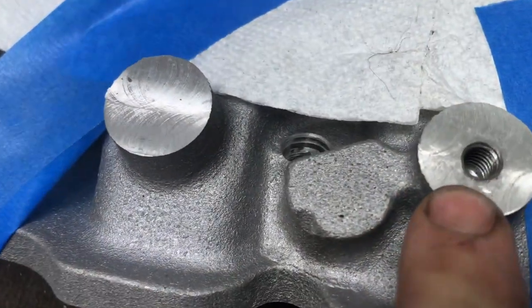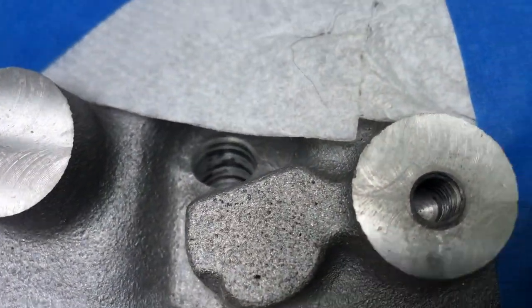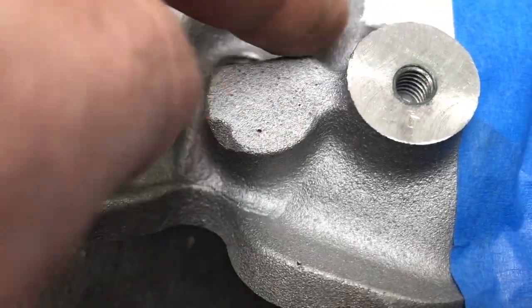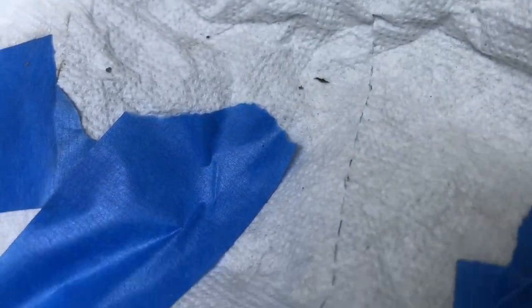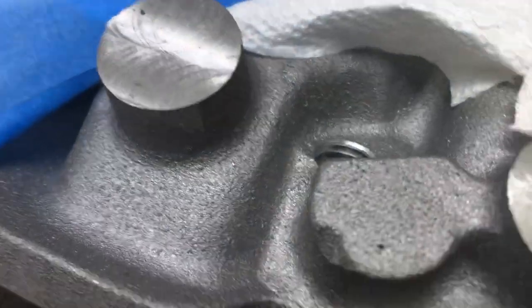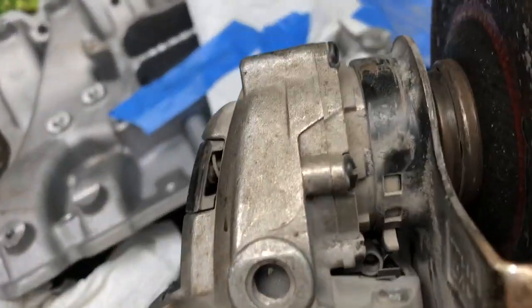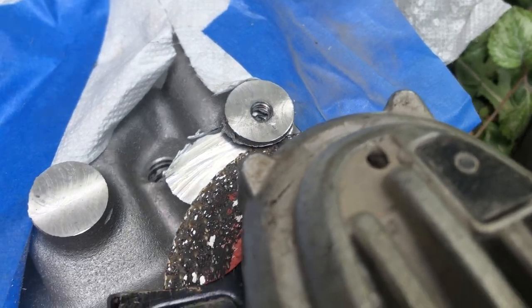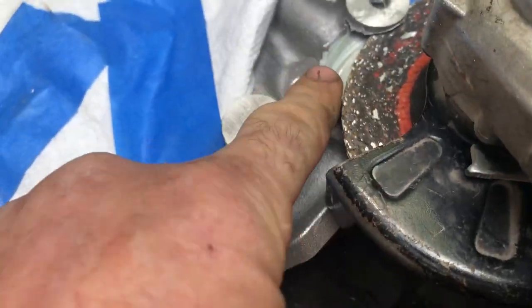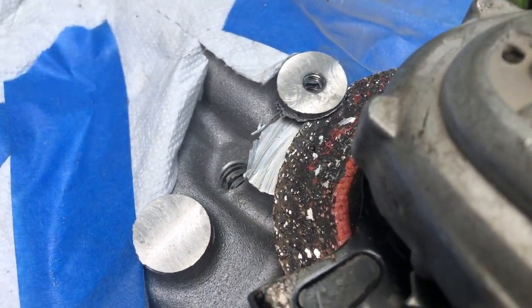Using the picture as my guide, there's still going to be a little dimple in there - I obviously don't want to go below the bottom of that hole. What we may do is start by cutting it flush with the top and then measure how far this is coming up on the other one. Using my grinder with about a 1/16th inch cut-off wheel, I went down the depth of the blade on this piece here - that's how I measured.